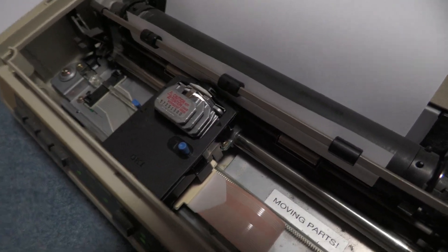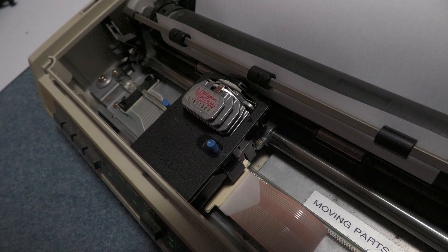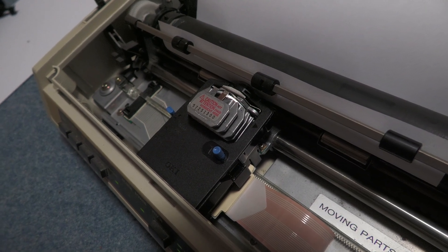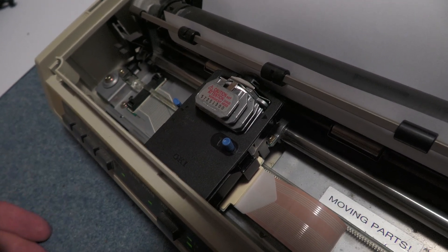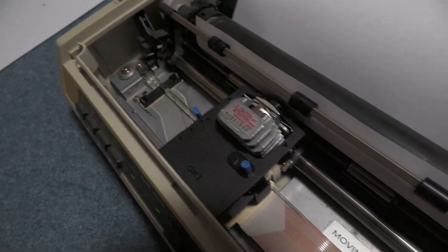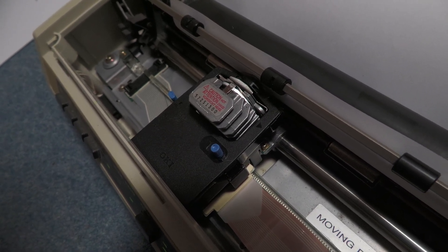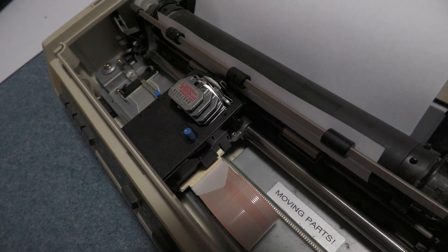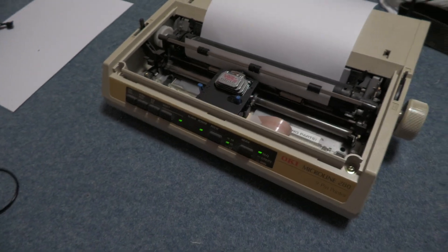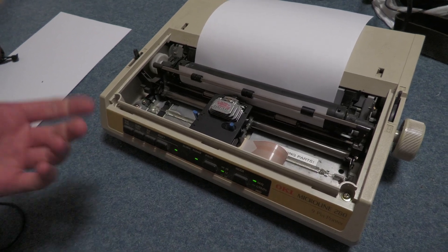A few years ago I wondered if it might be a fault. I thought the printer was practically dead and useless anyway, so I took it to pieces — it doesn't really matter if I break it. Unfortunately in the process I managed to break one of the pins off, so what was a 9-pin printer is now an 8-pin printer. I can't remember if I disconnected the thermistor or replaced it, but I put the head back in, and whatever I've done — lo and behold — the printer works. The alarm light no longer flashes and it prints absolutely fine, albeit with a missing pin.